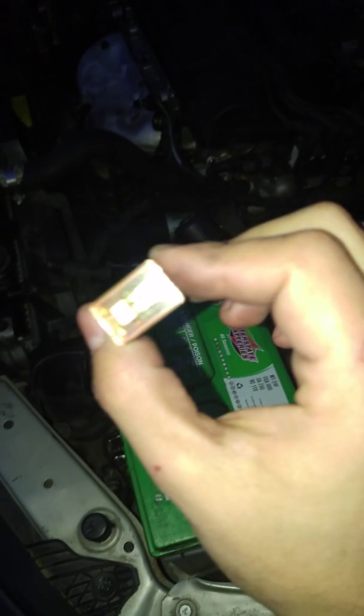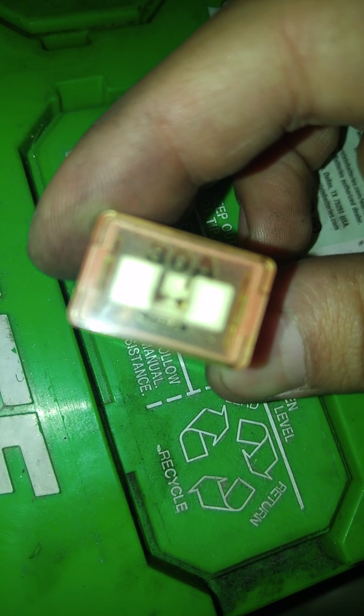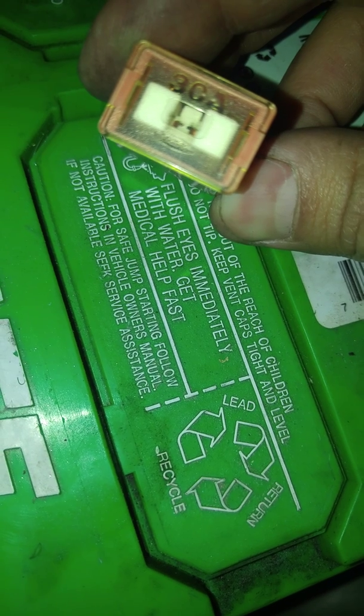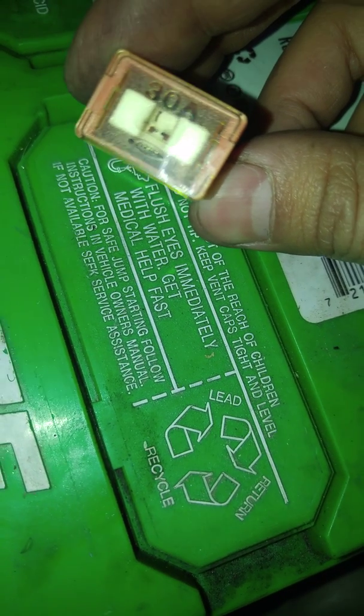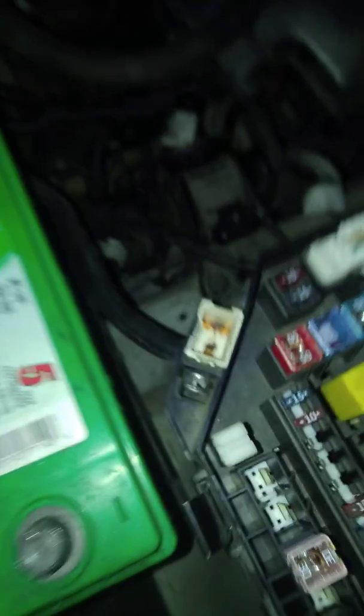100% — I confirmed that with my test. Isn't that crazy, guys? I just wanted to do this for the fun part. I think all this stuff is so much fun, so if you call me dumb for doing it, I don't care — that's what I like to do. There we go. 30 amp fuse is blown. And remember, this blew a 120 amp fuse. There's absolutely no resistance to ground — it's a straight hook to ground. Basically me jumping this with a heavy gauge jumper cable. Pretty exciting.